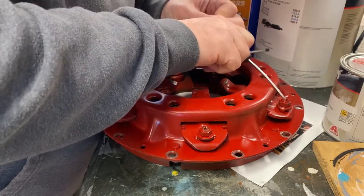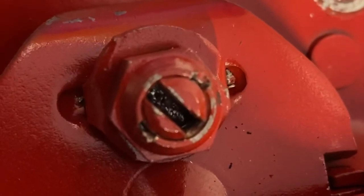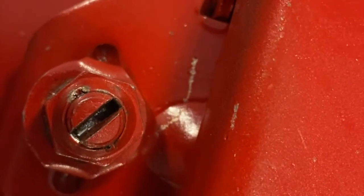Before the fingers can be adjusted, we need to unstake the bolts. Using a thin flathead screwdriver as sort of a hook, I reached down into the gap and forced the left and right tabs up and broke them off. Some people like to use a hacksaw to file them down once they're upright, but we found that ours pretty much all broke off, so this wasn't really necessary.